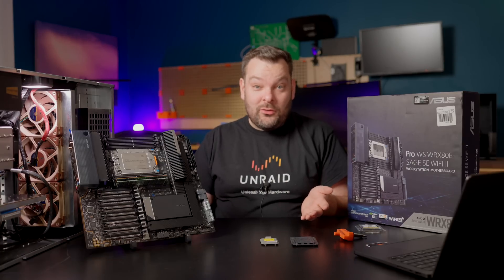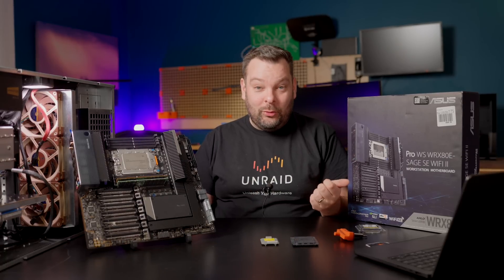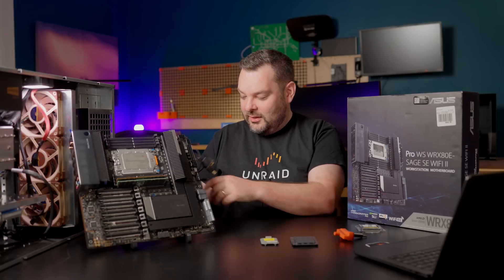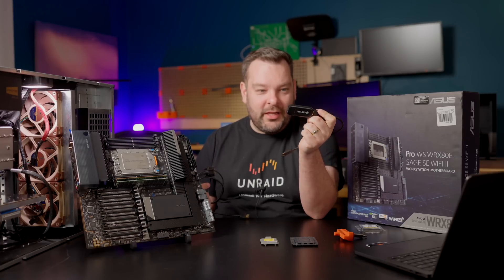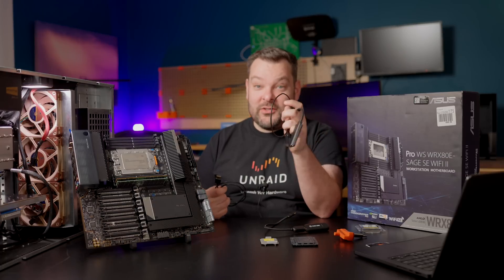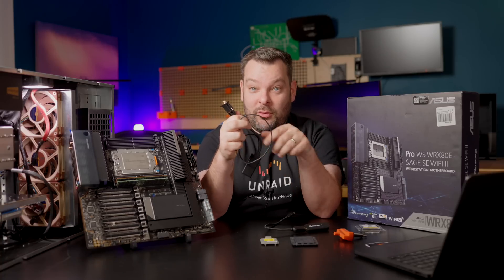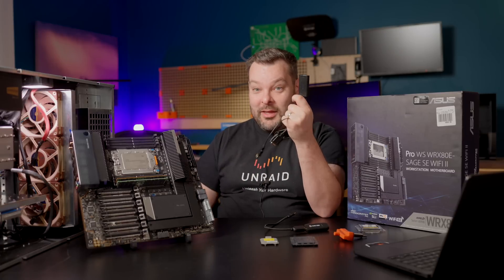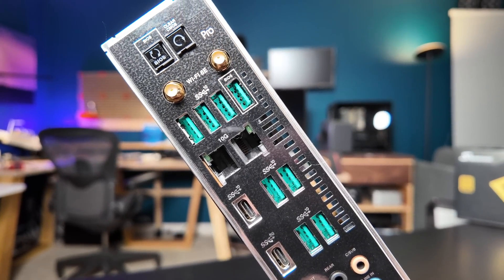Once the CPU is installed, it's time to try and power it on. But I didn't want to carry a monitor all the way to Charlotte as well — monitors are quite delicate things. So why not use my brain? I have an HDMI capture device here — this is just an Elgato Cam Link 4K. And from my KVM downstairs, I have a VGA to HDMI adapter. This thing powers itself off a USB port and takes the VGA input that the motherboard spits out and outputs an HDMI signal. This motherboard doesn't actually have an onboard VGA port — it comes with a little connector that plugs into a port on the bottom of the motherboard and outputs VGA.